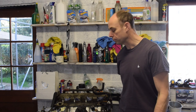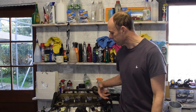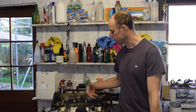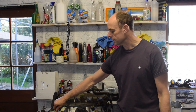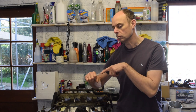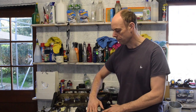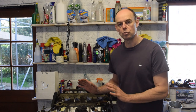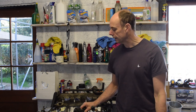I think that wraps up this week's video. Pretty good week I'd say — obviously last week we got the engine out and on the stand. This week I've been focusing on getting the top clear, ready to take the heads off. The fuel metering came off, the water bridge came off with a lot of fighting and one snapped stud. I've also managed to free up the seven remaining spark plugs, so they're all ready to come out. I've just started looking inside the cam covers and I'll order a long-nose socket set allen key so I can get in and get good connection on those bolts — I've been warned about those stripping. Join me next week where I'll be trying to get those heads off. Please subscribe and I'll see you next time.